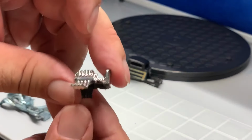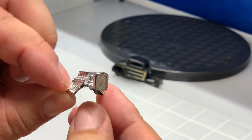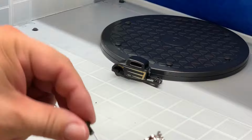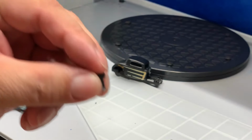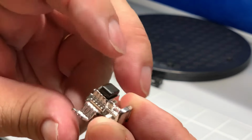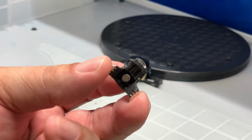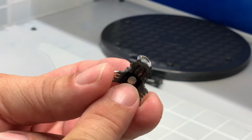And this is what I had here. It's got the radiator and everything connected to it. I've gone ahead and filed down the engine ahead of time because it was just sitting up too high. Now the scoop out of the top of the engine was also the post that held the engine into the 32 Ford. So I've gone ahead and ground that down also.